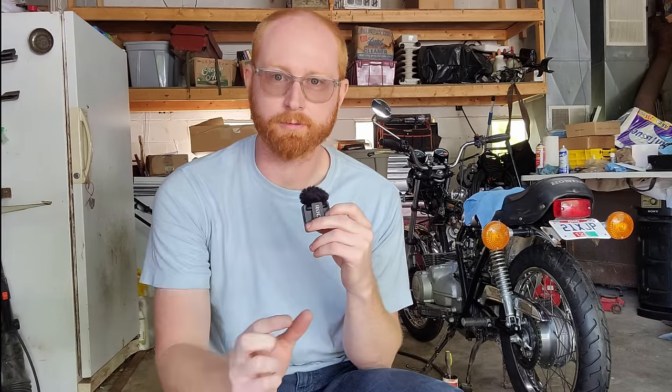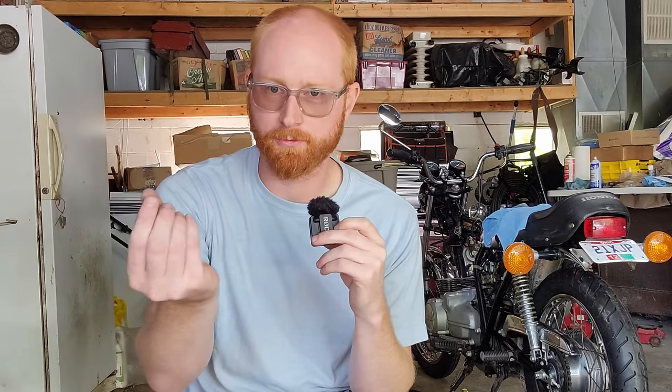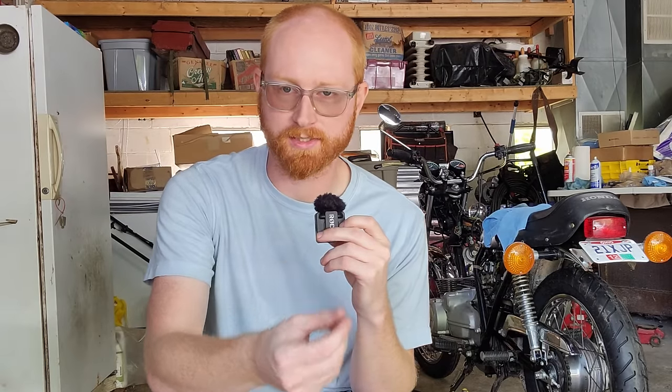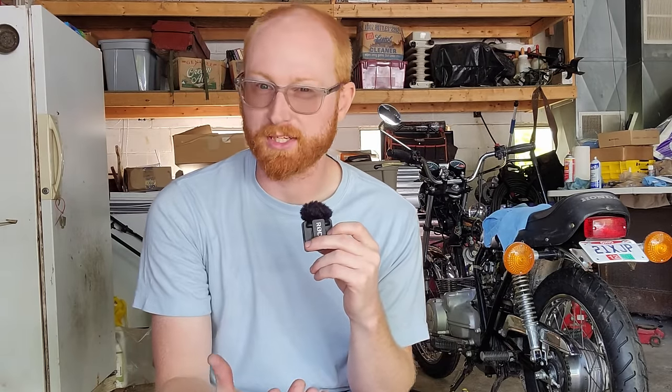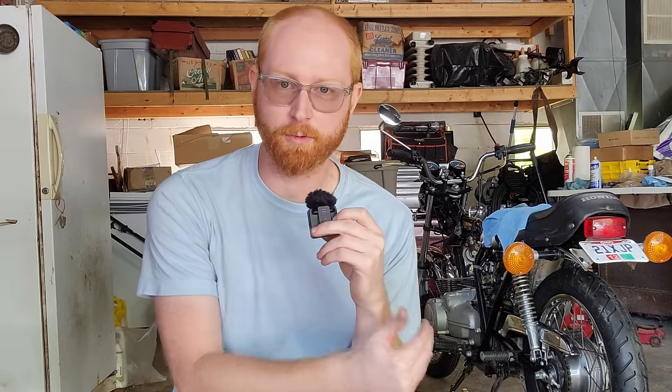All that's left to do on the bike is put the head gasket on. We've got a new head gasket imported from Japan. This one's actually a little bit thicker than the stock, and it has some metal rings around the oil orifice, so hopefully this one won't leak. The past one was kind of dripping oil from the head gasket right around the pressurized oil orifice. It's a pretty common problem, I take it, because there are several different options for upgraded head gaskets on these if you order from Japan.